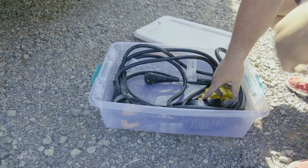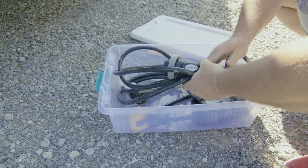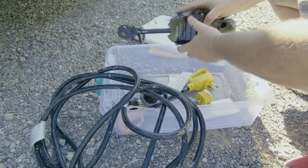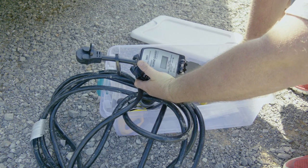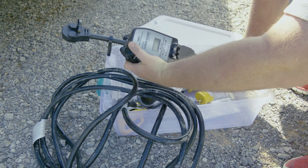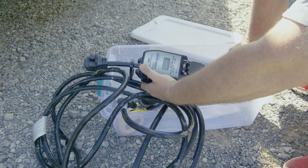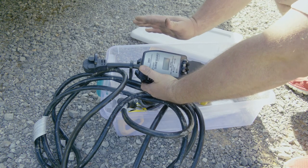Here's the electrical bin. This cable right here hooks up and goes into the camper, and this other end goes into the electrical outlet. Always use this — it's a surge protector. Camps are pretty weak on power at times. We've had a renter where there was no ground; he plugged this in and it gave a warning signal. He had to alert the campground and they fixed the ground shortage. This saved the camper. If there's a storm, lightning can cause power surges and completely fry the entire camper, so always use this.